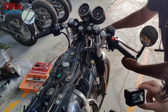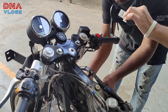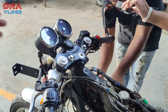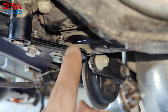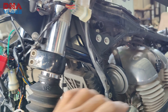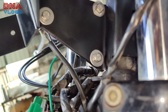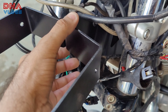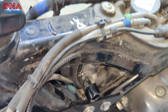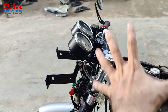There are already two holes in the chassis on which the bracket sits — you don't have to drill any hole. Both brackets slide in from the front and get locked with lock nuts on the back side. Once you put both brackets and these two bolts in place, don't tighten them yet. First put all four bolts and nuts through the four holes from both sides and tighten these completely so there is no movement between the two. Keep the main bracket bolts loose — that free play is required to adjust the complete fairing.